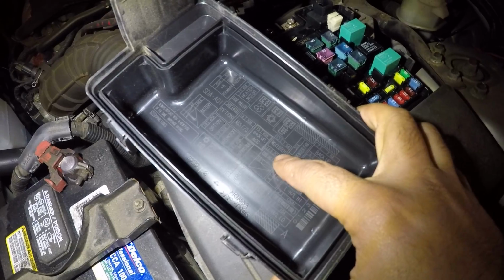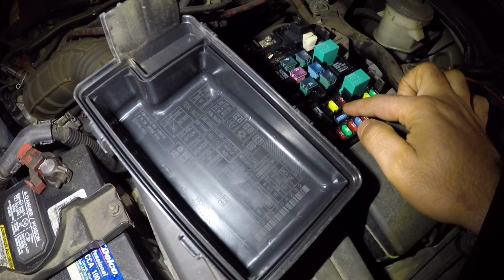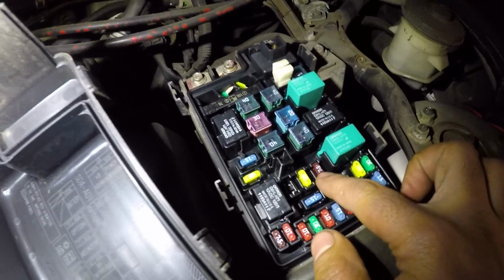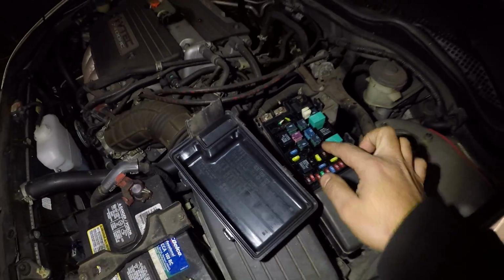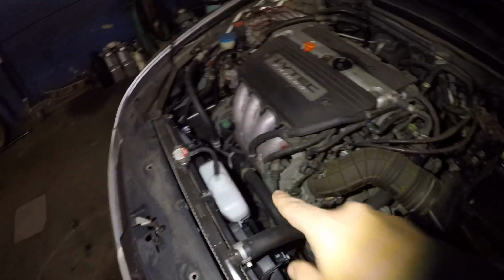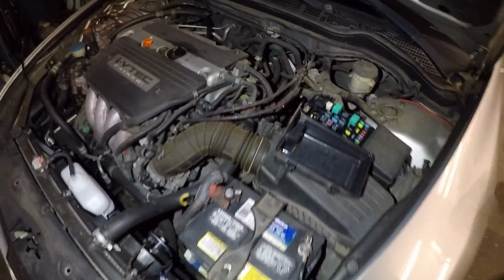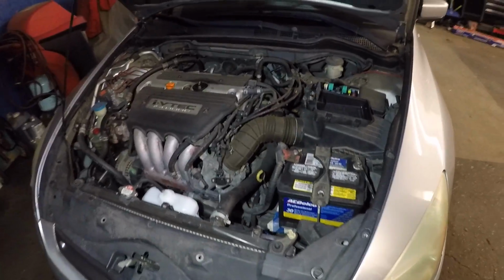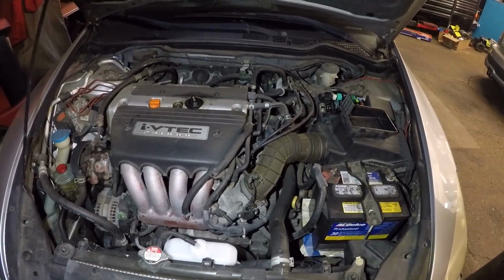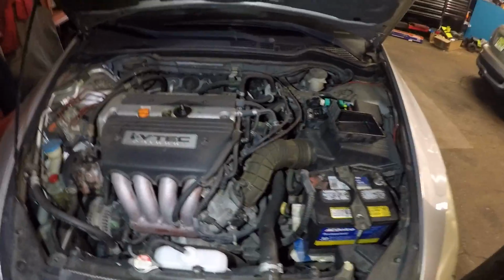Okay, this one says MG clutch. 7.5 amps. This 7 amp fuse right here is for magnet clutch, right? So this and this, they work together to give power to the AC compressor. If there's no power, even if you hear the relay clicking, guys, the contact has carbon, is not making the power travel through, right? Simple, guys, very simple. Do these little steps. Take a look at your relay, swap it, change it, put a new one in, and you're good to go, right?